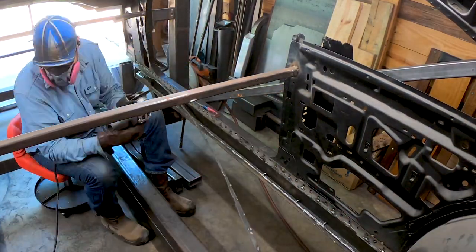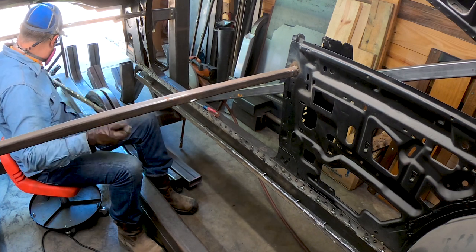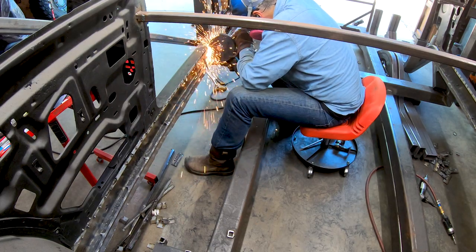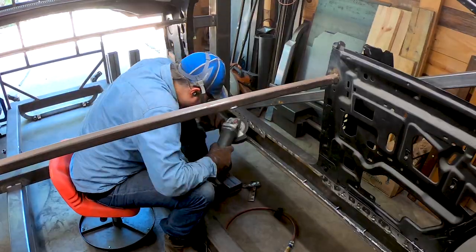It took 2 days to clean up the rest of the unibody, mostly the rockers, before I could get a clean set of measurements for the inner rocker plating. I still had the dimensions from the Rev 1 design in my notebook, but wanted to check again before drawing up the new inner rocker plates and sending that design off to the laser shop.